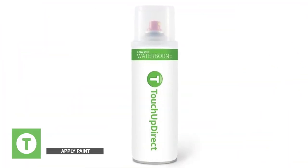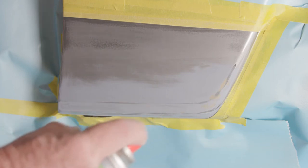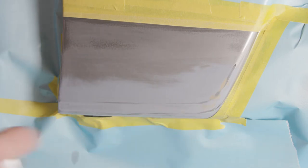Touch Up Direct uses water-based paint, so remember to shake the can very well. You're going to try and stay where the primer is — spray only to that area for the first couple of coats until it's covered, and then we're going to do a little blend. You're going to have to be about eight to twelve inches away from the area, and don't press the trigger too fast — just kind of fan it. See, there you go — you're fanning it, you're spraying downward.